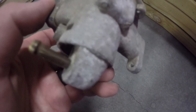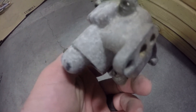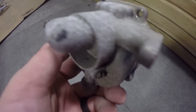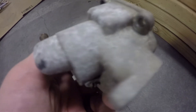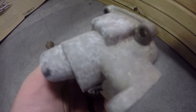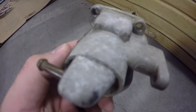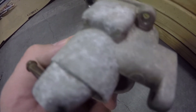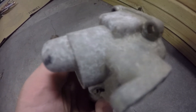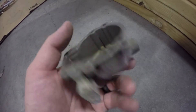It's just like a light film corrosion that typically doesn't come off if you just spray carb cleaner, acetone, or even gas on it. If you scrub it a little bit I've had it come off, but sometimes after everything dries out it kind of sticks around. So I'm hoping this vinegar acid will etch that off the surface and further aid whenever we go to clean it again with the carb cleaner - that it'll come off permanently and we'll get that clean metal look.